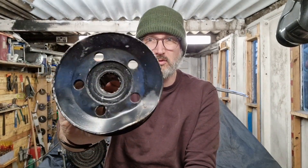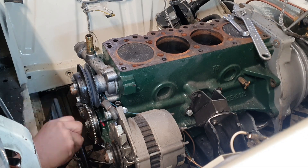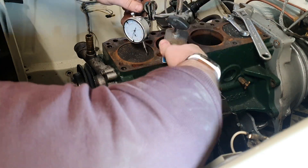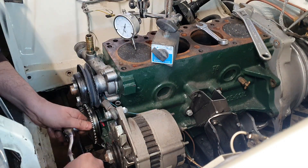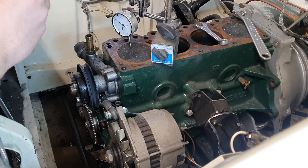I got the old pulley off — I have no idea why it got stuck the way it did, but it's completely destroyed and won't be going back on. It does show how flimsy these pressed pulleys are. Also, I need a new puller because mine is useless. Back to the front of the engine: the bracket went on easily, I'm pretty happy with that. Next up is setting the engine to TDC using the DTI gauge — it's been a while since I've set one of these up so it took me a moment.